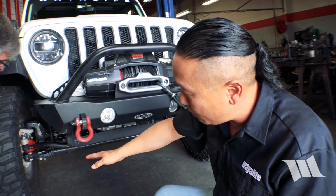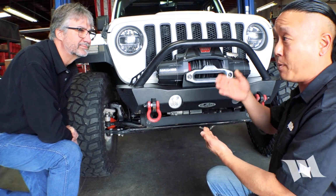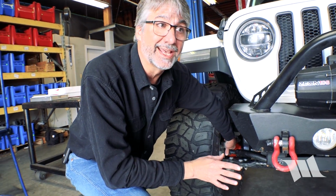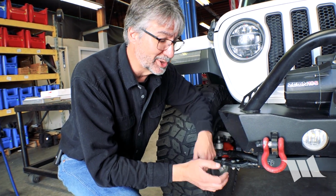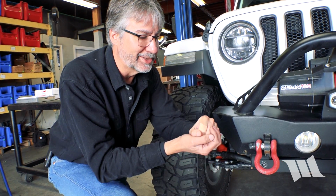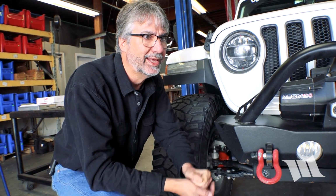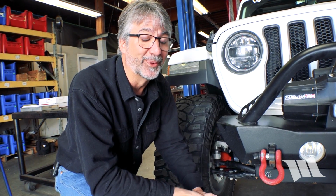But so what we're looking for now, I'm assuming just shifting up and down or shifting side to side? It's usually going to be side to side. If it's excessive, it'll also be up and down. Right. Because remember that ball socket is sitting in there, so if you push it far enough, it moves up and down. But usually you've got severe wear at that point.